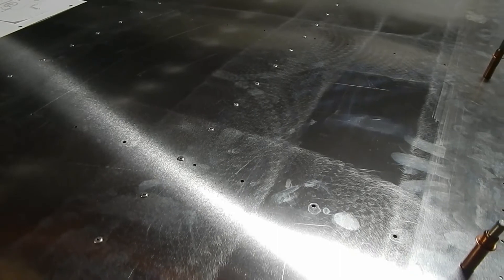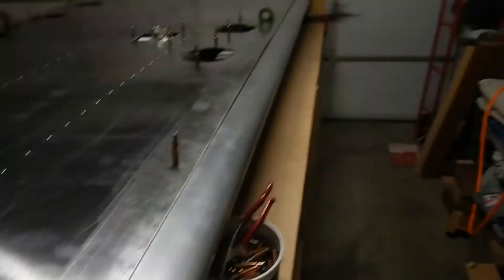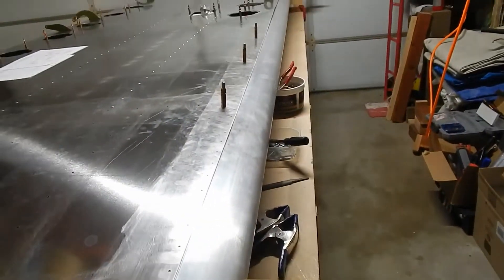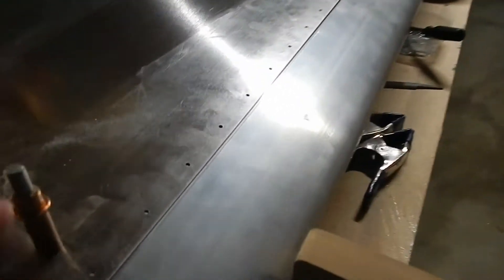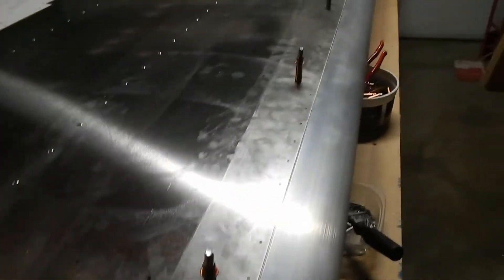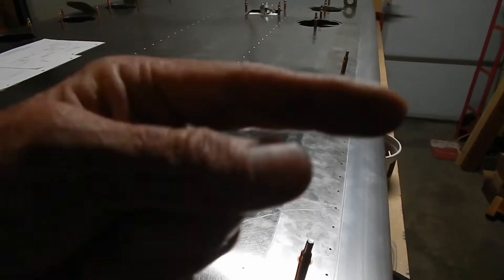That service bulletin was written in 2019 and I got my kit late in 2021, so I'm not sure why this is still a problem. I did fix it on my other wing and it looks like I'll have to do it on this one too. A lot of people on the forum said they didn't have this issue, but I've checked my twist, leveled it, clamped it, used the provided brackets — everything is dead-nuts on — and I've still got the gap. I can see the stringer is against the ribs and it's not going to come any further, so I'm removing all the clecoes, pulling the skin up, and going to grind those ribs down about an eighth of an inch.